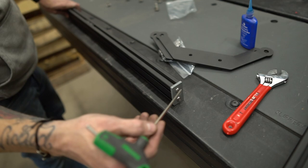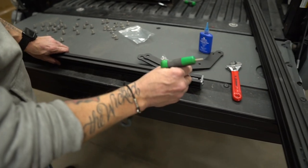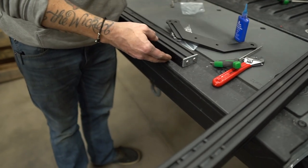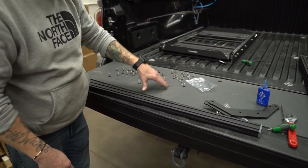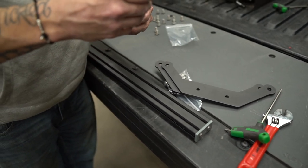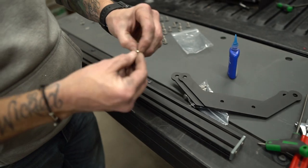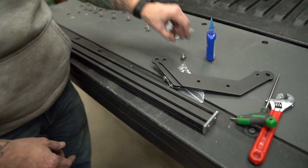I've got your load bars with these caps already screwed on. We put them in there because we pre-load these for you so you don't have to fight with them — it's one less piece you're going to lose. The slides will go anywhere you want — that three-hole slide will correspond to the slot in the truss leg. Each contact point where a load bar goes into a truss gets three bolts per side, so six per load bar. The truss-to-load-bar connection doesn't actually get a lock washer. It's going to rely on Loctite and the stainless flat washer. With a steel fastener, a lock washer actually makes it really hard to get apart later, so on this one we only use a washer and Loctite.